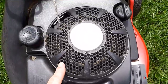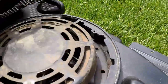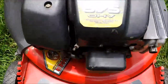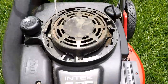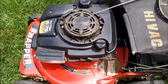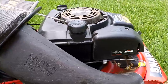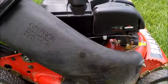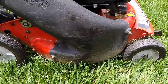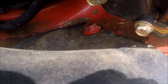We're going to remove this little decorative cover, which will give us access to the bolts that remove the gas tank from the blower housing. There are also some cover bolts up front, and I'll have to remove the dipstick tube. There are a couple of bolts in the back of this cover as well. I'm also going to go ahead and remove the side chute and bag to get access to the gas tank bolts in the back, since we're replacing that side chute anyway. The side chute has three bolts — all half-inch — two on the outside and one on the inside.